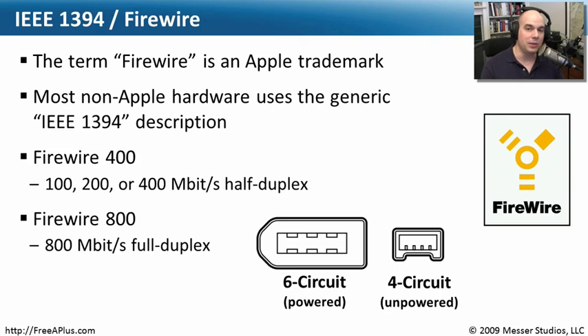This is a very standard format. Even though it was created by Apple, it was standardized by the IEEE. So you'll also see this referred to as IEEE 1394. You might also see it referred to as iLink. There are a number of different names that manufacturers have given to it, but it's all the same thing. You could plug in IEEE 1394 connections into a FireWire or an iLink device — it's still FireWire. It's all the same behind the scenes.